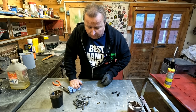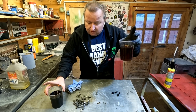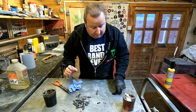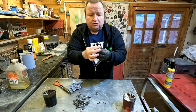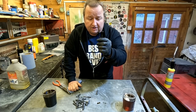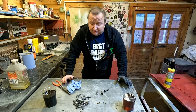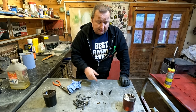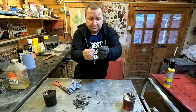So there you go. That's what we found out with our plating. It doesn't appear to make much difference if you're using clean or dirty engine oil. Either one will apparently give pretty much the same result there, as you can see. But what you should have are bolts that no longer rust anyway. I have done a little bit of it in the past, but I've never done the comparison between clean engine oil and dirty engine oil. I've heard people say that if you use clean engine oil, the part comes out clear. But obviously that's not the case.